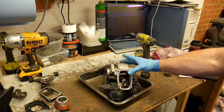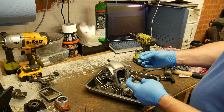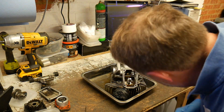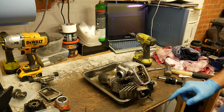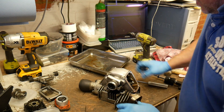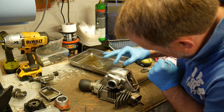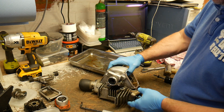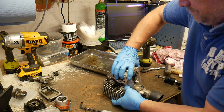Let me just get the tool so I can pull the rocker arms out, keep them as a matched set, and just make sure you've got the shims. Let's get the closing shims off. Because the valve sits so much higher up on a two-valve than a four-valve, I'm just going to pack it with something - I'll just use the rag - that means I'll push it down, get the little clips out, take the closure shim away, and we are good. We can pop the exhaust valve out, turn it round, same again.